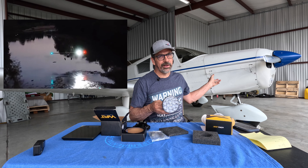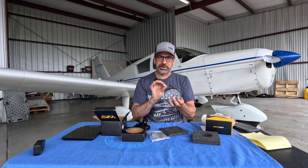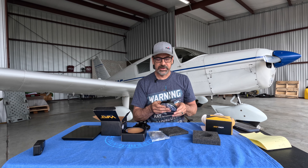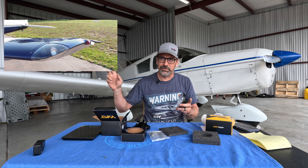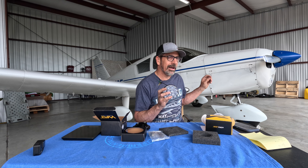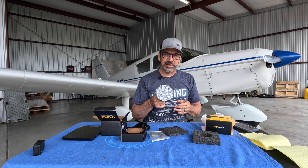In my configuration I just have one landing light, so I'll use the yellow wire for the wigwag function — it'll just go on, off, on, off — and the other two wires will get capped and stowed. I am ordering new wingtips for my plane that will put wingtip lights inside them, so I'm going to buy two more of these lights for those and use the wigwag function there. For now I'm just going to cap and stow all three of those wires and use this purely as a landing and taxi light.